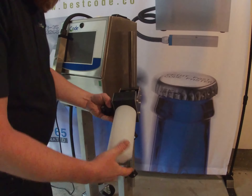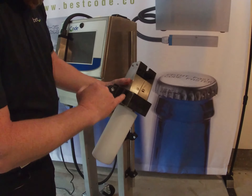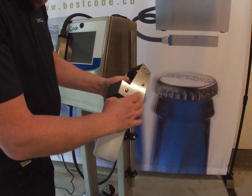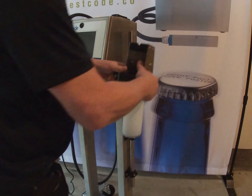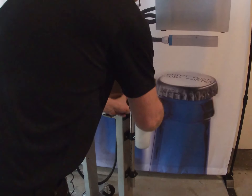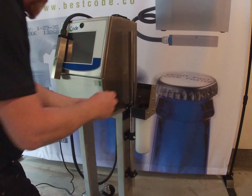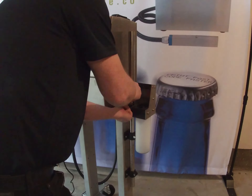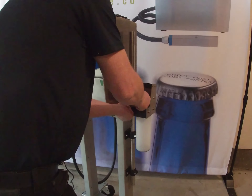This is the wash station — it has a detachable bottle at the bottom. It comes with universal brackets, so this bracket here goes onto the post. The two fixing holes are also on the other side, so we could actually have it on the opposite side of the printer if necessary, but this is a good configuration. I'm going to slide that on all the way down as far as it will go, and then using the Allen wrench tighten this up to stop it from moving around.